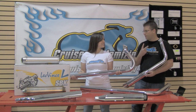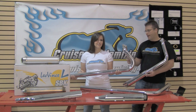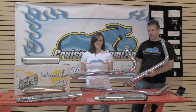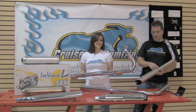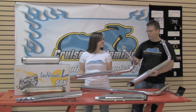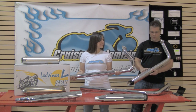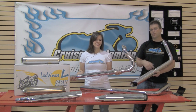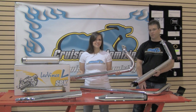Most of the full system pipes out there are going to come in two different styles. What Kelly's holding is basically a true drag pipe from Samson — as you can see this is one single tube that goes all the way from your head all the way to the end of your tip. Whereas this pipe here has an aftermarket head pipe in addition to a slip-on muffler. Another key difference is the fact that this drag pipe does not have a heat shield, whereas this pipe here the muffler's not going to blue and it has a protective heat shield over the top. So make sure when you're picking out a full system set of pipes you have one that has full length heat shields if you want to eliminate any blueing.